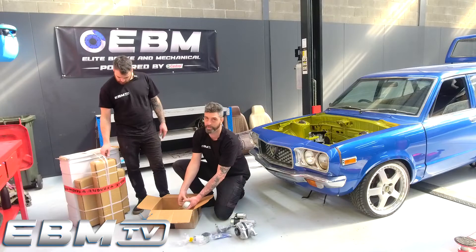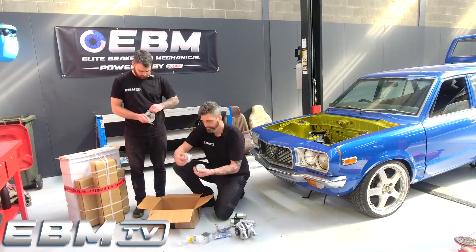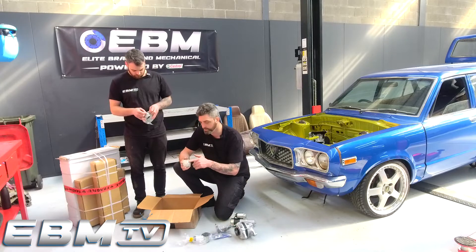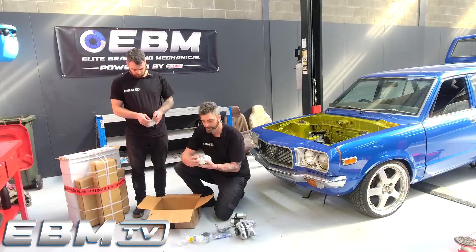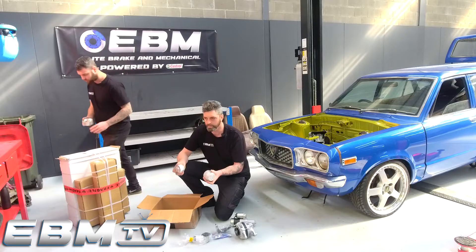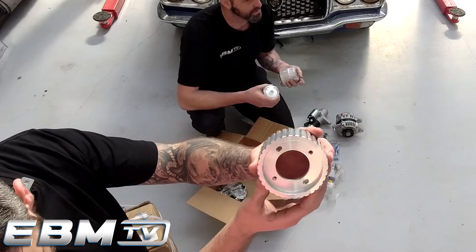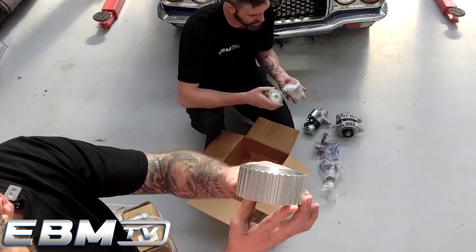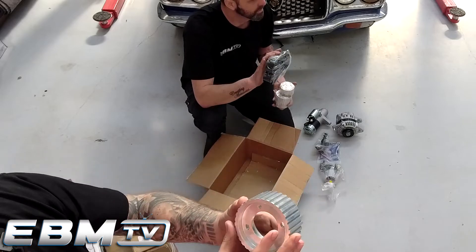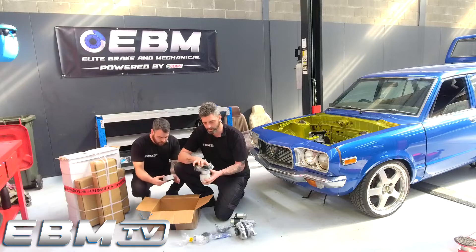And the best part — the fun part — the Gilmore Drive pulley. The reason we had to get the alternator in first is the pulley's a bit loose on the front here. I had to take it off to measure the hole for the alternator. There are a few different sizes, so it will depend on what size you have as to what set you need. Your man was very helpful — gave him a ring, he asked me to measure all the sizing, asked what water pump I had, all the different information that we needed, and he got it all sorted. Comes with all the bolts that we need as well, and also the new Gilmore pulley. I think we'll try and get these fitted today at least and then go from there.